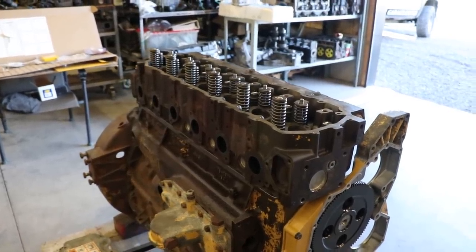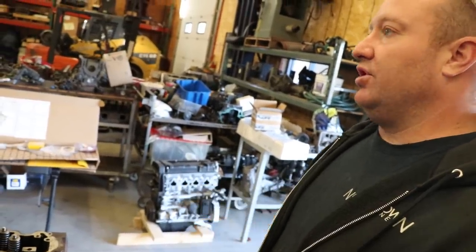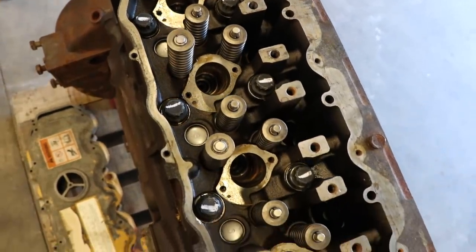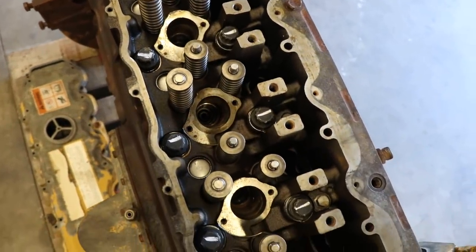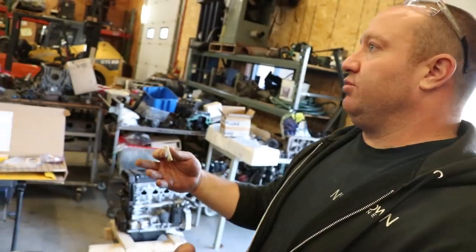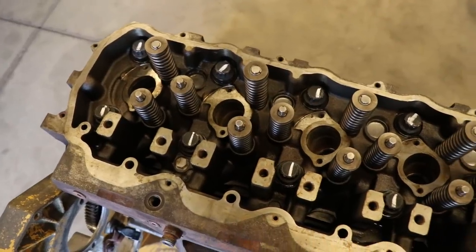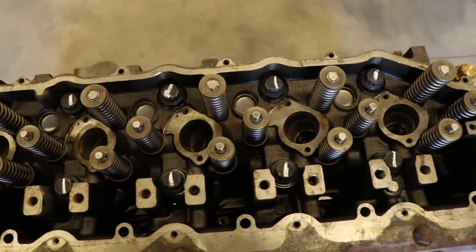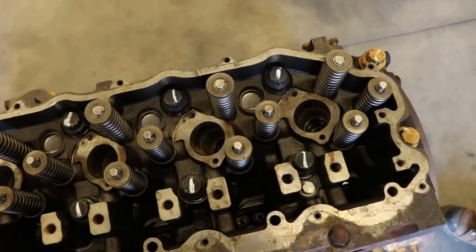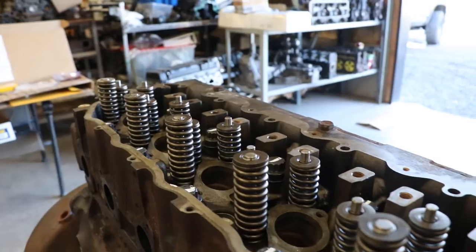I'll just let this sit now and relax, and the stresses and stuff, because just pulling up, especially on a torque like that, some people might relate that to using torque plates on a build, right? Right, right. They torque the plates up on the block, that distorts the block, and then they hone and bore to that, right? Right. But does the book call for a hot torque or no? No, I like to tell all my customers to always retorque the head bolts when they have a situation they can. Some customers follow it, some customers don't. Right.